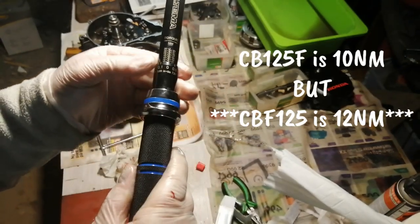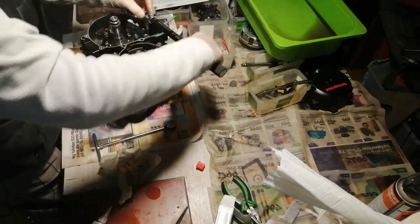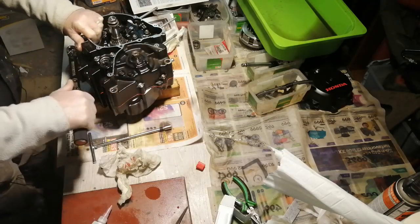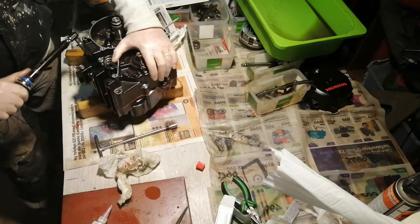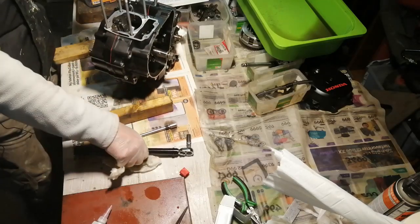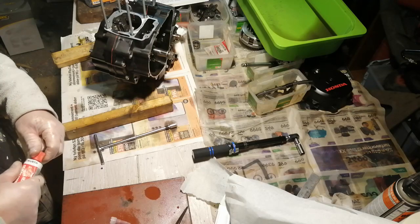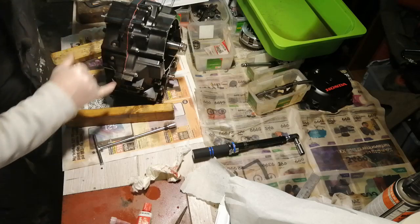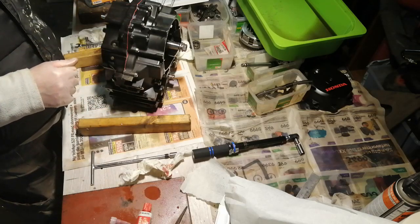You can see that it's 10 Newton meters. Double check, double check. I think there's about enough sealant in there to do about 10,000 engines. Looks good — thin line. I'll take that off with a blade after, because I read somewhere that if you wipe it off now there's a chance you could pull some out. I'm not sure I believe that.